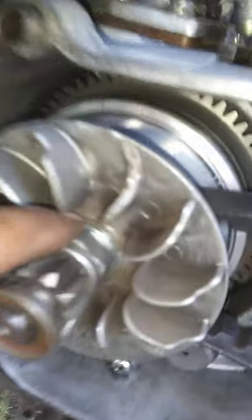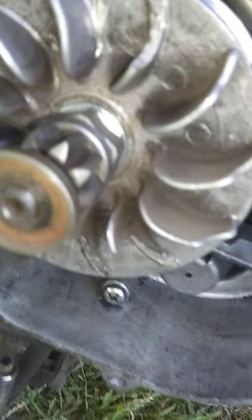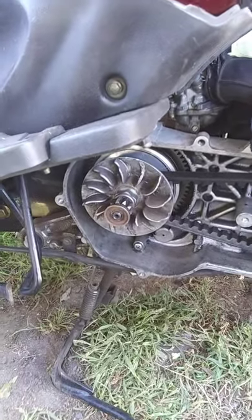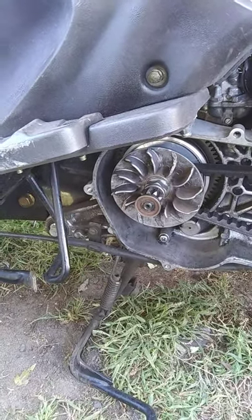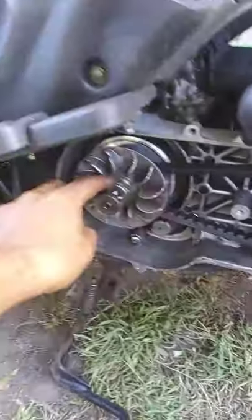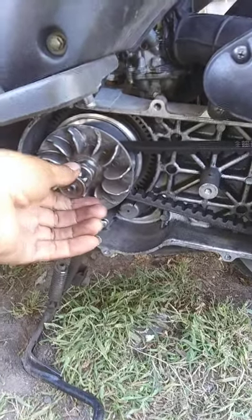So what I did is I went to my hardware store and got a washer and put that in, because once I had over-tightened it, it wrecked some of the threads and I couldn't get it snug. I was thinking maybe I should use some Loctite — I didn't. I also have some fins broken on here. I just put the washer in and it got snug. It's a little bit more tight than normal.